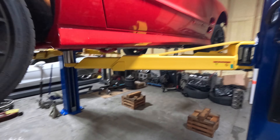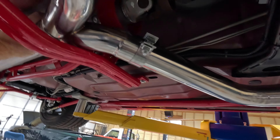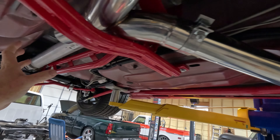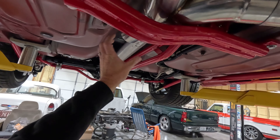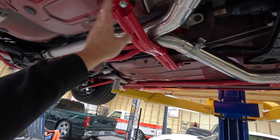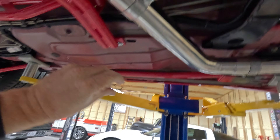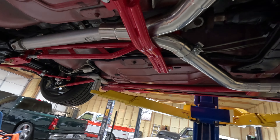Then I'm probably going to move to some grounds that I need to hook up and then under the hood. Well, this is not going well guys. I told you I was going to put this on. I've got it somewhat in place, but if you'll notice, it's hitting the drive shaft loop and it's also hitting here. So I think we're going to have some adjustment to make — this thing looks to be shooting off into the blue moon. We may have to grab our cat back. I may have to scrap this altogether, or I may end up going with a trans-mounted torque arm if this is going to be a problem. Even if I go with the transmission-mounted one, if I still want to run a drive shaft loop, a lot of those bolt to this area here. So I don't really know what my next step is.